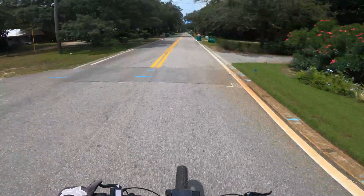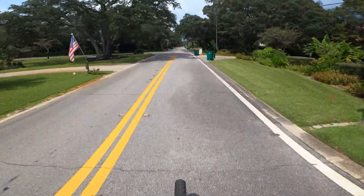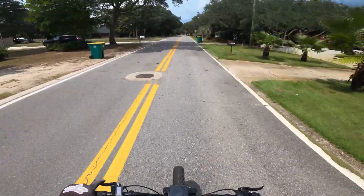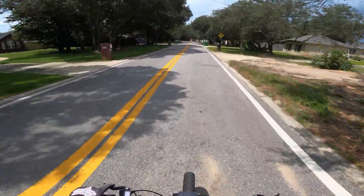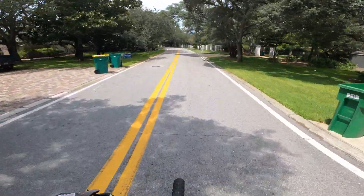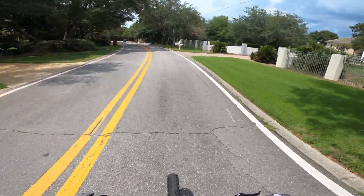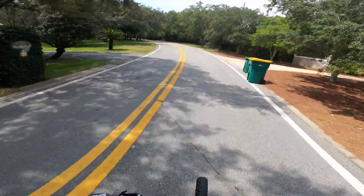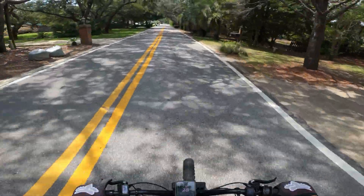With 40 amps of field weakening I'm still only able to reach 52 miles an hour with a stock battery — still 52. That's not bad though, considering these bikes are rated at around 45 to 48 miles an hour with a stock battery, and the 60 volts that come with the Suron are kind of becoming dinosaurs at this point. That's some pretty good performance to get out of this battery with a controller upgrade from Torp.